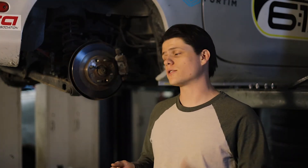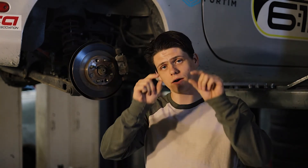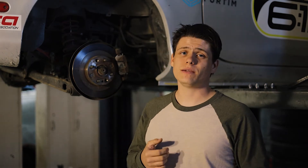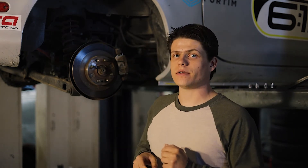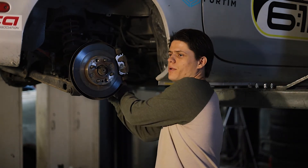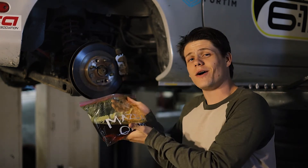We got the car up in the air. First things first, we're gonna go ahead and loosen up the brake caliper hardware on all four corners and check the brake pads. We're looking for evenness of wear and also overall thickness. After that, we're gonna nut and bolt the brake system, and then nut and bolt the rest of the hardware that we can get a wrench to. To nut and bolt a car simply means to tighten up anything that could fall off and unintentionally cause you to knock a competitor out of the race.